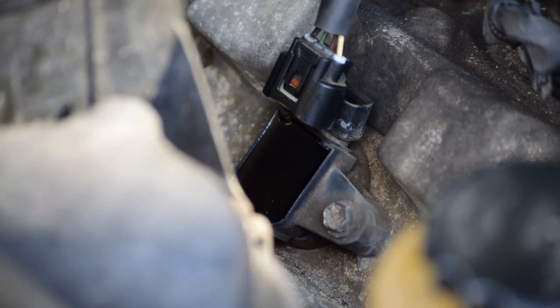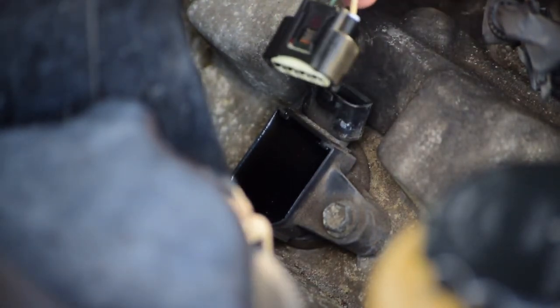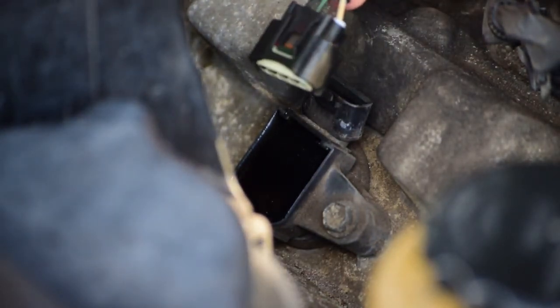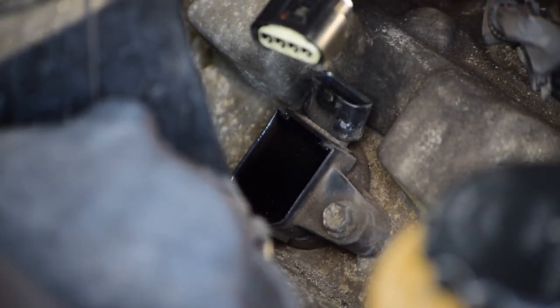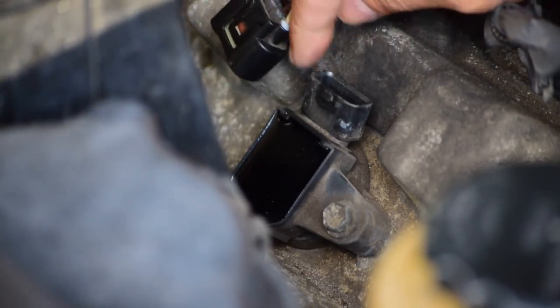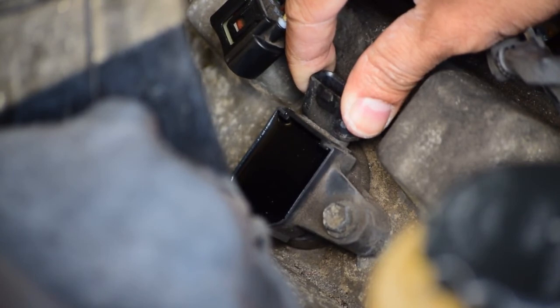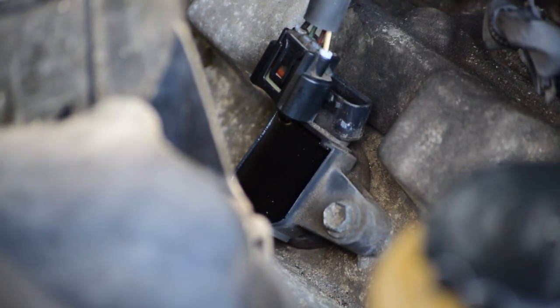That's why that's been the best way I've ever been able to take the connector off the ignition coils without breaking it. Because if you break this, you've got to buy another connector, cut it, splice it together to have a proper connection. Once this tab breaks, it's not going to lock into your ignition coils anymore, and then you might have misfires and all sorts of other problems just because you weren't mindful about removing it properly. So just try that out when you're working on your spark plugs — hopefully that saves somebody some headaches down the line. Thanks for watching.